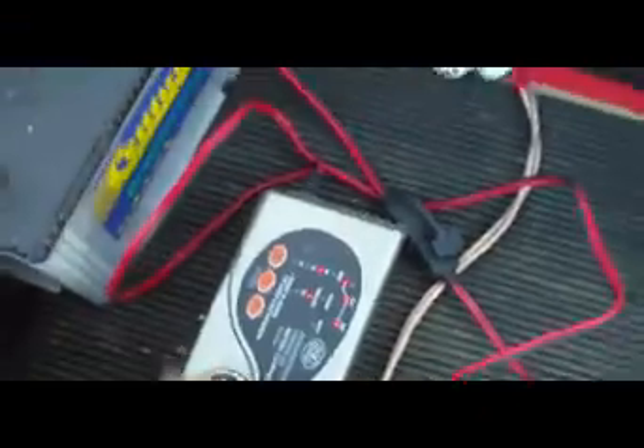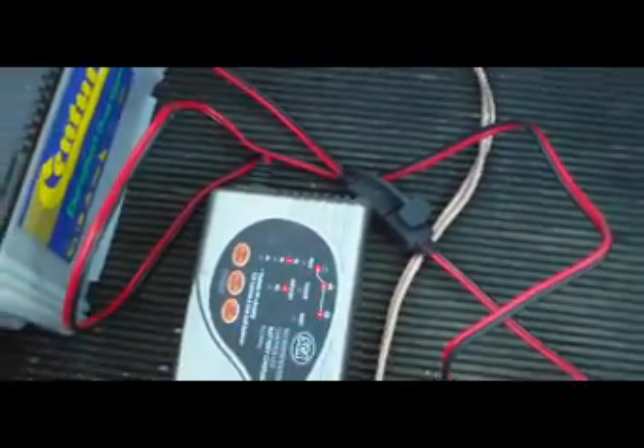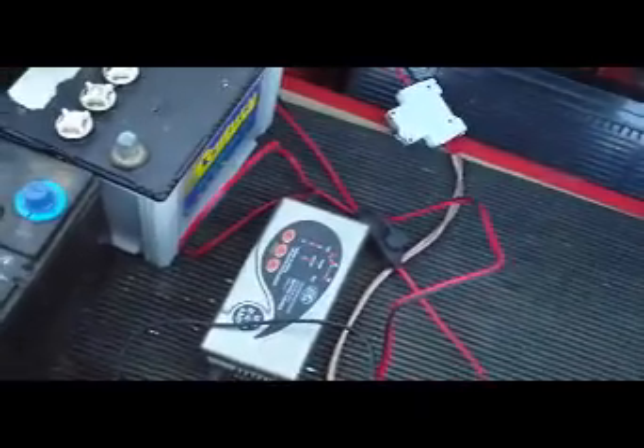Every night I'd come home and slap this charger on. It's got an eight amp charging program — it's only actually eight amps during the bulk charge phase. As soon as it starts getting up towards the absorption stage it drops to a default of about two amps, no matter what setting it's on, so that only affects the bulk. I simply made up this cord so I could shut the boot without risking damage to the cord that came with the charger. It's plugged into an extension cord, sits out overnight, and it's fully charged again ready to go the next day — in fact it doesn't even take all night.